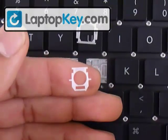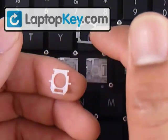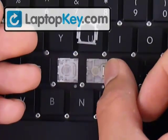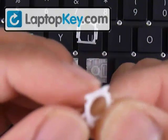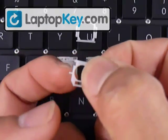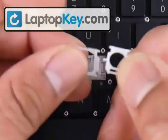This piece has two pins at the top, so they're going to click onto the key cap. The pins in the middle are going to click into the large piece, and the bottom bar is going to go underneath the large metal hook that's on the keyboard. Make sure not to put this piece upside down either — by feeling underneath the vertical bar. If you feel bumps underneath, that side faces the keyboard, and on top it's supposed to be one smooth piece. This is the right position for both pieces.